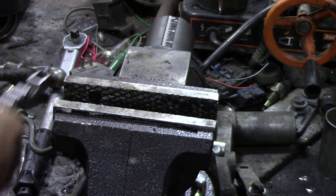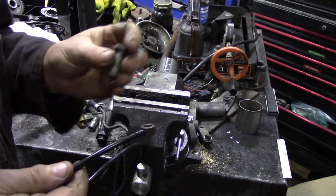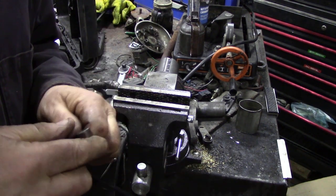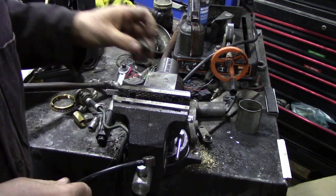Perfect. Now you can do that with all fuel lines. So instead of buying fuel lines like you used to do before, just use that method, but remember to support the banjo bolt, because although it doesn't take much tapping, you might find a hose that's a bit bigger and it'll collapse that bit. Better being safe than sorry, and all it is is a 10mm bolt.